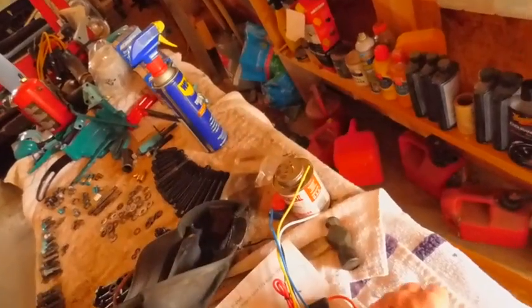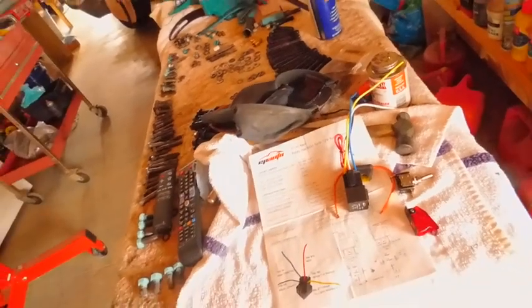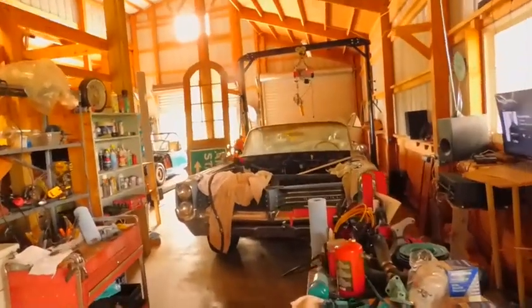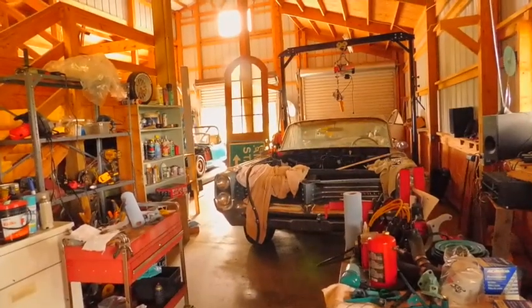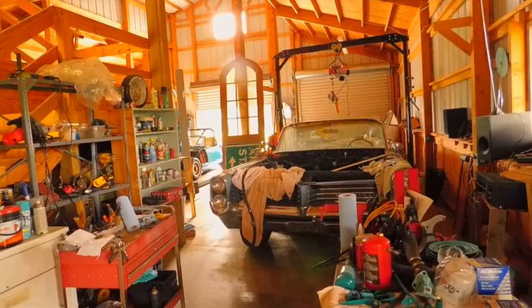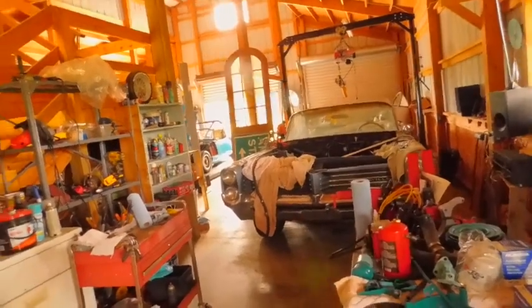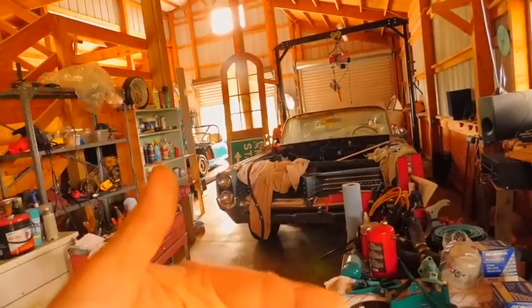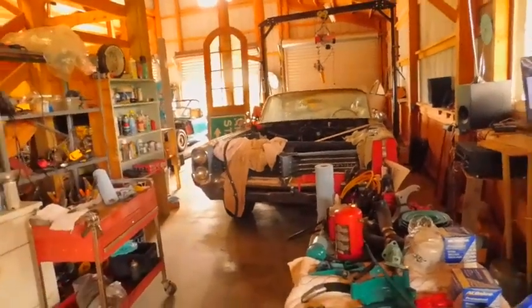And so you just got to keep your eye on this stuff. Don't run much more than 20 amps in a car. It happens, power windows, power top. This one does. I think the T-Bird had like a 60 amp circuit breaker. And Jack called me about a 60-something Riviera convertible, and I said, trust me, you got to have them big, heavy-duty circuit breakers. On Fords, it's usually around the front near the solenoid. It just depends. Just look it up yourself.